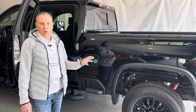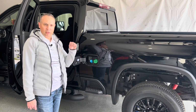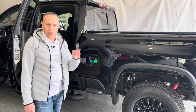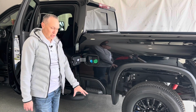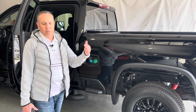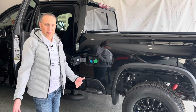It's the exact same formulation. It's all the exact same stuff. There's a certain percentage that it has to be of urea, and there's another component in there. For it to call itself DEF fluid, diesel exhaust fluid, it has to meet those standards. So this is approved for all diesel exhaust fluid systems. There's no reason to buy the more expensive kind. Just get the cheaper kind you can find. As long as the date's good, let's put it in.